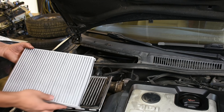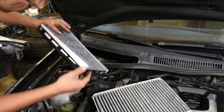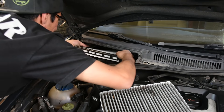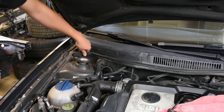A lot of that smell is just caused by a bad cabin air filter. I swapped mine out here — you can see the old one is pretty nasty. I also vacuumed the inside of the cabin air filter housing since there was debris there too, then put the clean cabin filter back in. Now there's a nice fresh smell coming into the cabin.